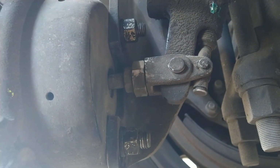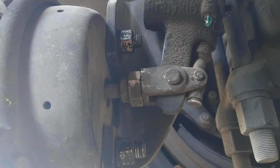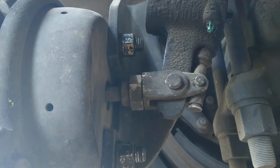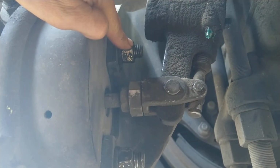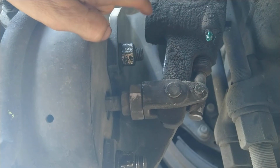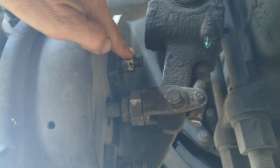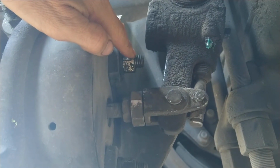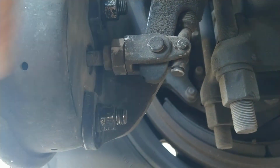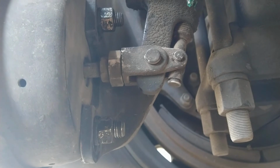So I saved a minimum of an hour, likely 2 hours, because of the struggles to get things to line up right, by just going ahead and using a combination wrench here to pop this loose, and then a gear wrench to rotate it quicker, to take it off, and then same thing to go back on and tighten up, and then, you know, being able to use the impact and extension down there.